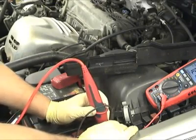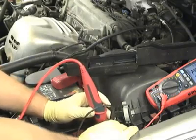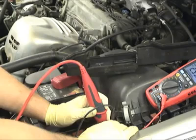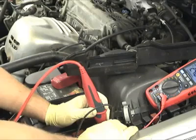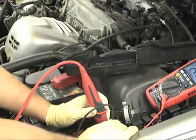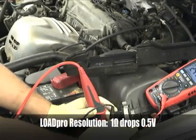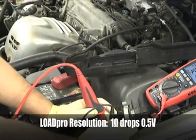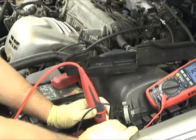Right here with 100 ohms, hitting the horn — we've got 12 volts, but now we input additional load into it and we drop our voltage down 2 to 2.4 volts. Under load, it's just loaded voltage. Instead of reading voltage, the answer to your question is now you're reading loaded voltage. That's the difference. It's a huge difference.